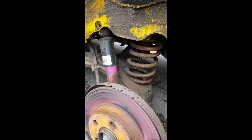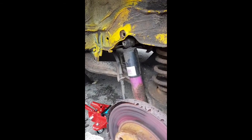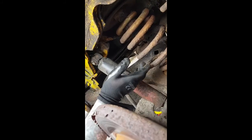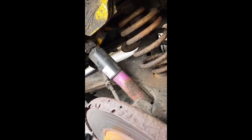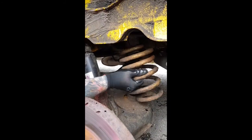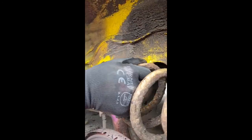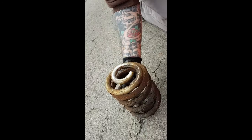Here he comes. So I can see now, looking at the spring, that the front curl is facing the back and the top one is facing forward. So I can lift the spring up and out, checking for any bump stops, the rubber. So we'll see if we can lift him up and out. There he comes. Here's the old. So we'll grab the new ones and then we can compare the two.